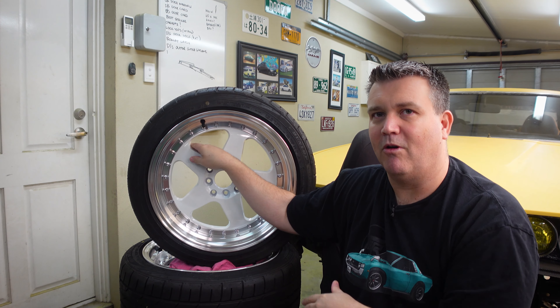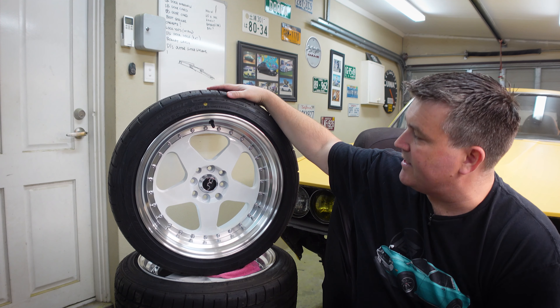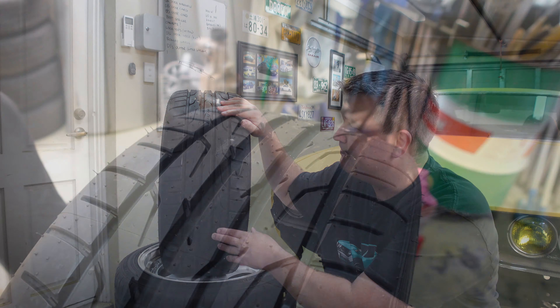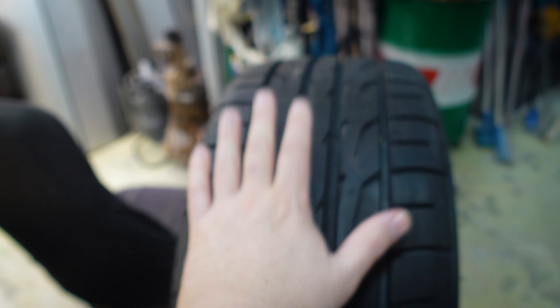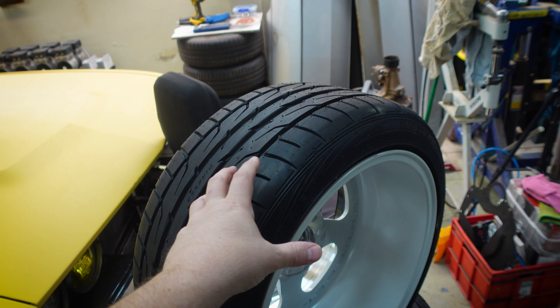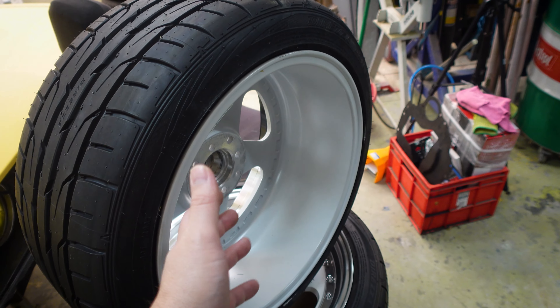The fronts are 215 and the rears are 245/40 R17 on the 9-inch rim, which has more dish than the 8-inch fronts. The Direzza tread pattern is aggressive enough to look cool on a car like this. One note from the guys who mounted the tires: they were really easy to balance. That can go either way with cheap tires and rims, but on this 9-inch 245 wheel, there's only a single balance weight — which is impressive.